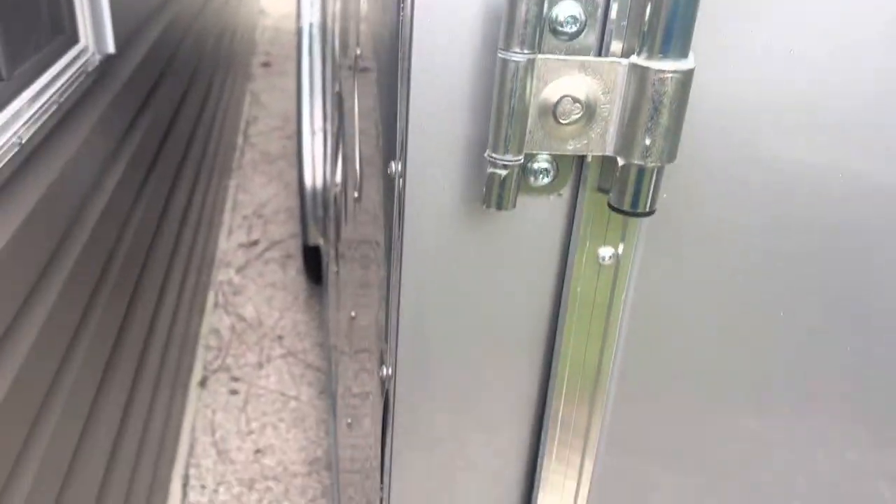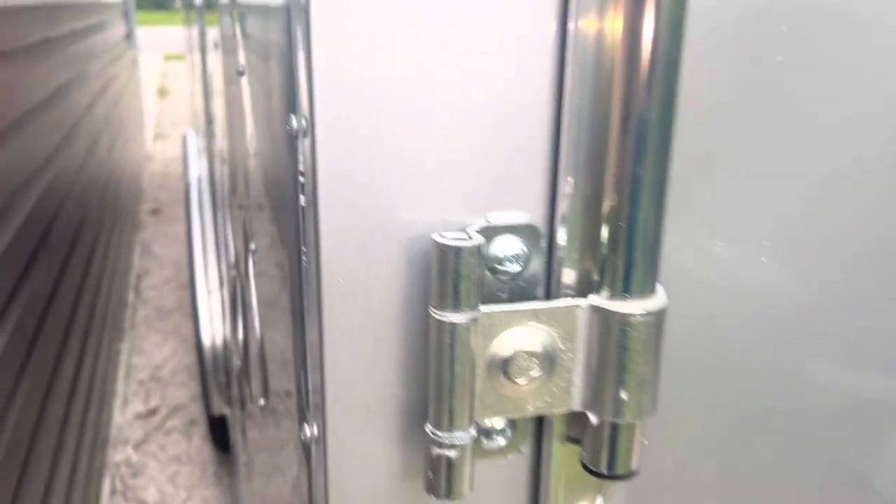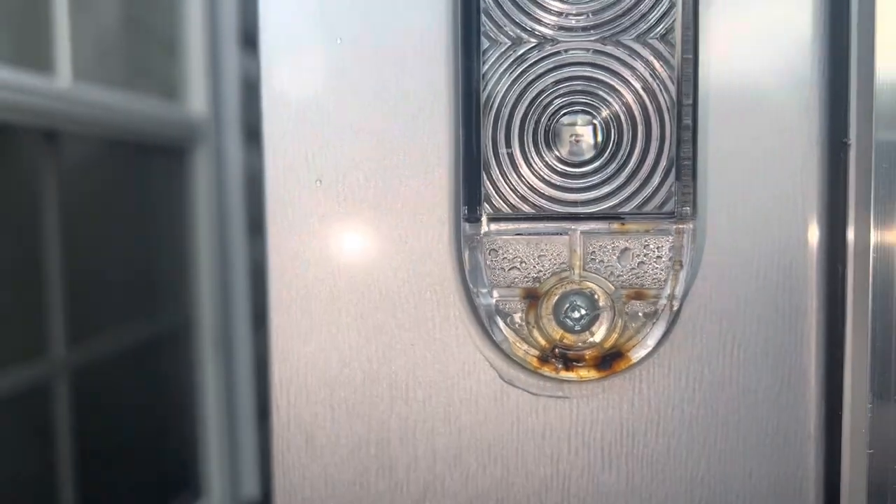I do have all the pencil marks off the side now. I've foamed the inside and put the walls back together. When I did that, I filled the gaps on the bottom ends with insulation so that water won't spray up inside behind the plywood where you can't see it. You can already see rust building in here — and I haven't even had this trailer for three weeks. There's already rust building in the tail lights because of the way they run the screws in there.